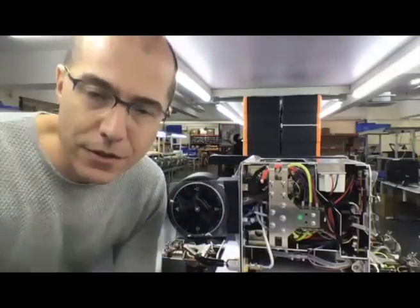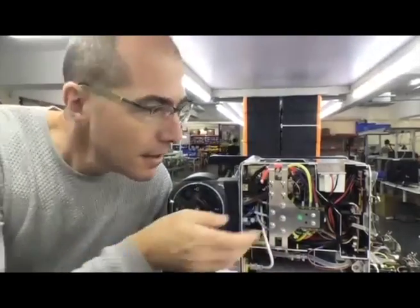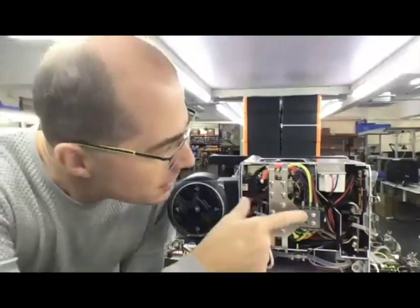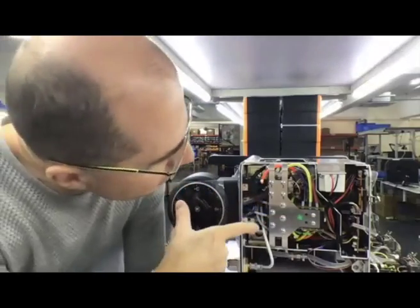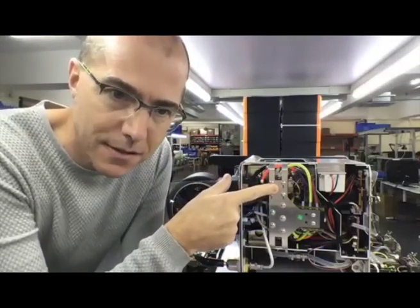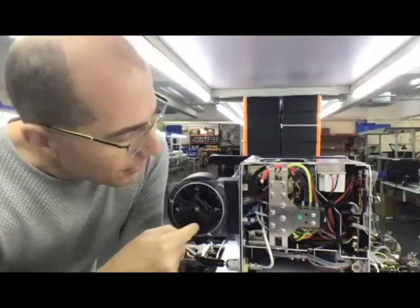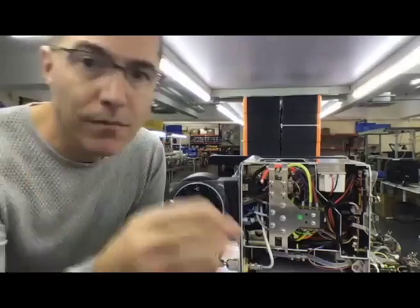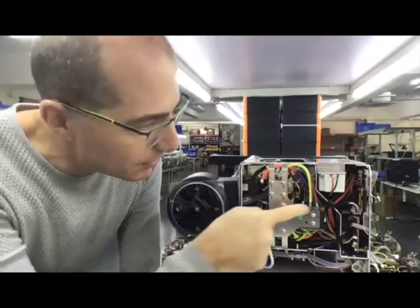The reason we control the individual AC pulses is that when we're trying to achieve a certain temperature, we measure the temperature here — see this brown tube? This is water going to espresso. We measure the temperature we want initially here before the espresso starts, and then when the espresso starts, we measure it inside with that probe. If we notice the water is too hot or too cold, we do one more cycle, or a few more cycles, of the hot pump or the cold pump to affect the mix.